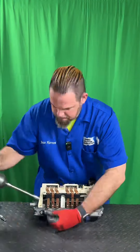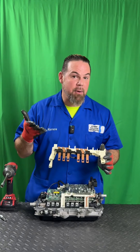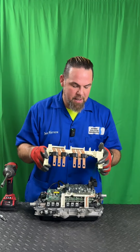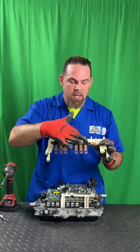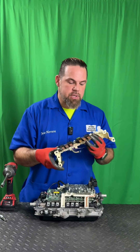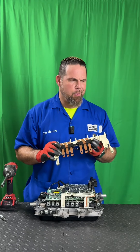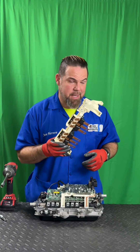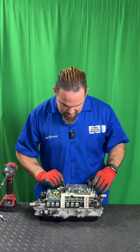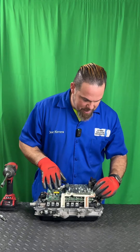The next component is the current sensor. If you hook up a scan tool in your hybrid electric car, you can monitor the amount of power and current the vehicle is consuming. This is done using four individual Hall Effect current sensors that measure each one of the phases of the electric motor. It is a replaceable part, though in Toyota vehicles this sensor rarely needs replacement.